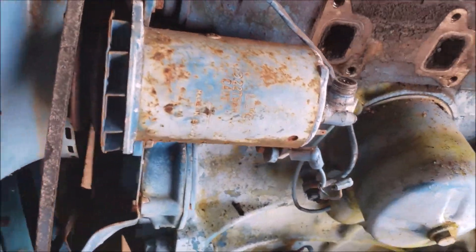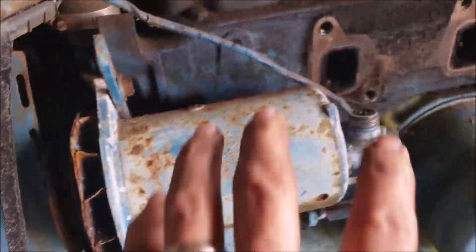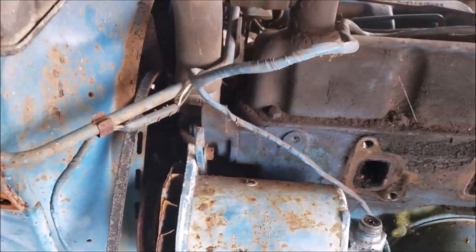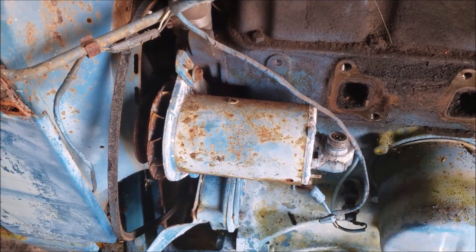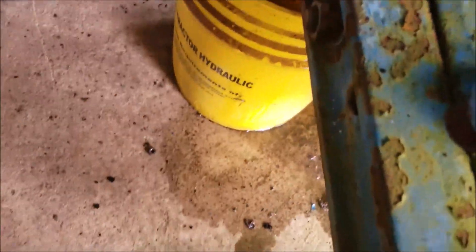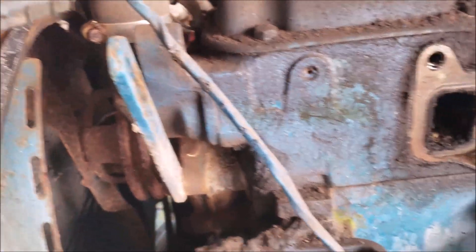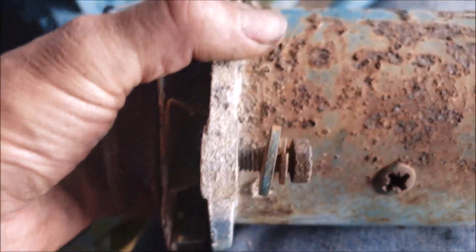The water pump is also frozen. I guess that's why they took this belt off - the fan does not move, the fan is frozen. I'm going to go ahead and take this off because I'll have to get to that water pump behind there. I'm going to take these off and start working on all this stuff around here. Everything is back to being standard - the only metric thing so far was the cover. Everything else has been 9/16ths and half inch. I'm going to put all bolts back on everything I take apart so I don't have a bunch of loose bolts.